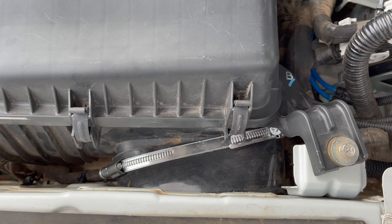He did say that the Y62 is a bit of a pain — the angles of the A-pillar, the way the guard sits, the way it goes into the airbox — none of it was straightforward. For example, the inlet into the airbox that joins the snorkel required a five-inch to six-inch silicone reducer, because the factory airbox has quite a large oval or rectangular outlet. Getting that to fit nicely was a bit of a struggle, but he managed to get it on there. I'll show you some shots inside the airbox so you can see how it's joined up.